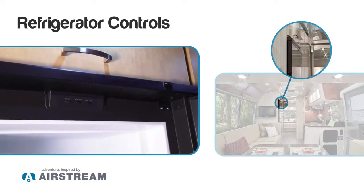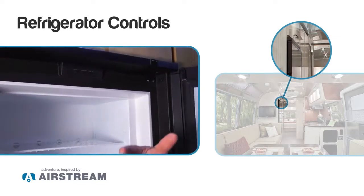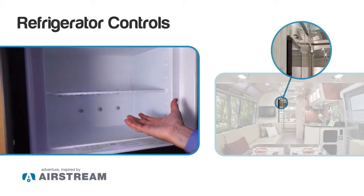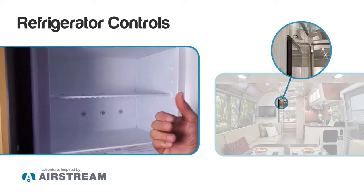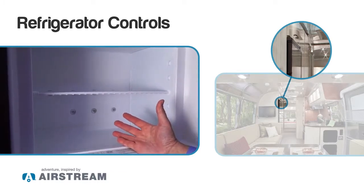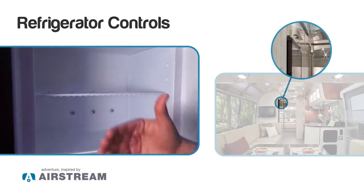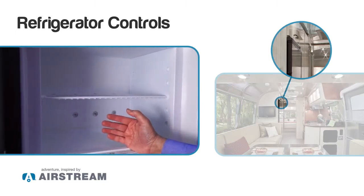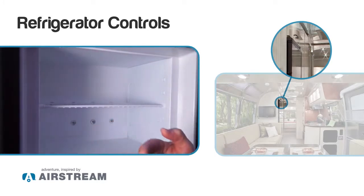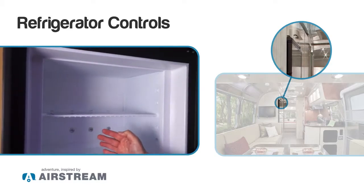A couple other things about the refrigerator. If you're going to go on a trip, you want to start cooling the refrigerator ahead of time, if possible at least 12 hours ahead of time. You're going to want to pre-cool the food you put in the refrigerator, because as I said earlier, this is an absorption refrigerator. It actually removes heat from inside the compartment. So if you start with a loaf of bread that you put in there at 70 degrees, it's got to get rid of almost 40 degrees to get it where it needs to be.